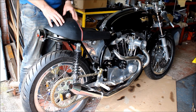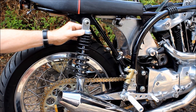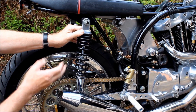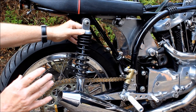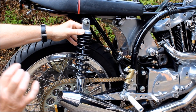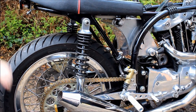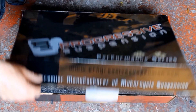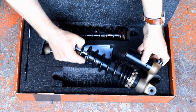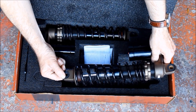I've been thinking about upgrades to the rear shocks. The current shocks are made by YSS — pretty cheap and cheerful, about £140 — but they only offer preload adjustment with no damping adjustment. I want a more modern shock offering infinite preload and damping adjustment, a slightly firmer ride, and maybe 10 to 20mm taller, as the back end feels a little low. Some time ago I picked up Progressive remote reservoir shocks with adjustable damping and preload, made to fit a Harley like mine, and an inch longer — perfect for my Norley.